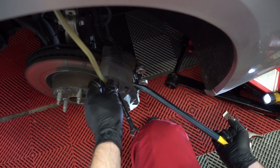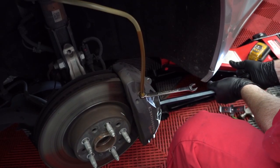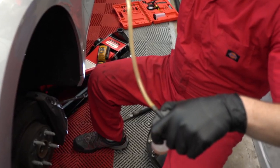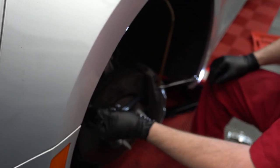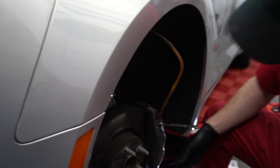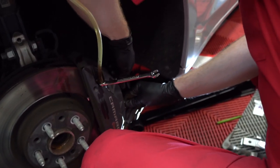We need to flush your brake fluid — that stuff's disgusting. I wonder if the fluid's just so thick? It feels like there's stuff in there — really nasty stuff. That's a horrible urine sample, chunks of metal, rust and stuff. I wonder if your pistons are rusted in there. That worked — squeezed that one in. That was really weird. I pushed it from this side and it was stuck on something that popped loose. I'll try it on this one — oh, there it goes. We'll get this pad in and let's flush some brake fluid through.